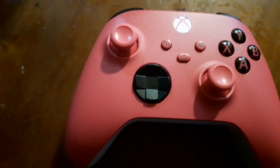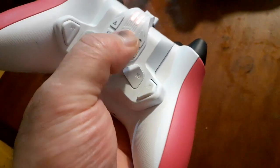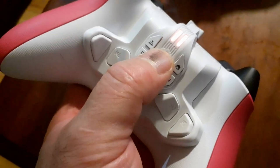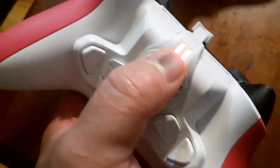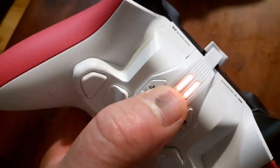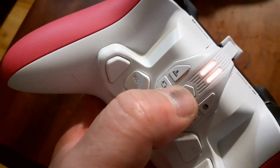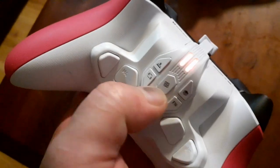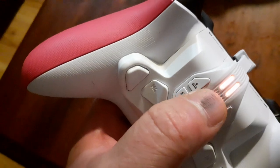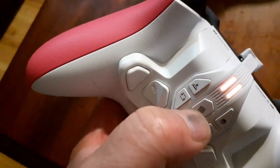I hope this video helped most of you having the same problem. Also, when you first update your firmware by connecting via USB cable to PC — the website and instruction video say to push and hold the hexagon button while you plug into the PC, and the light will turn off, meaning it's connected. But the first time I did it, it didn't turn off — it was like a green color. Doesn't matter though; the first time, I could still connect and update the firmware. The second time you do a firmware update, the lights go off as expected. So don't worry about it.